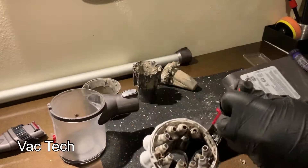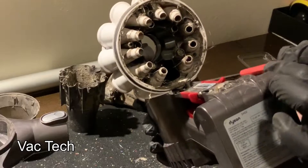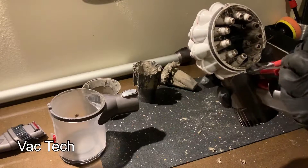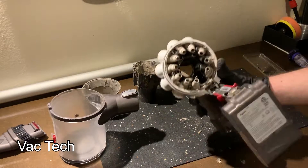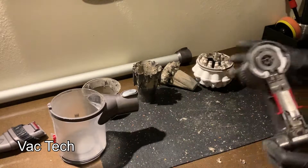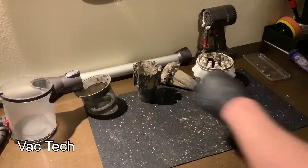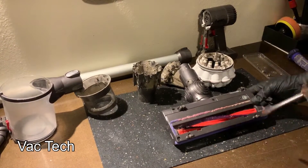To remove the cyclone itself, there are two small clips right by the motor — just push in on those. You can see they're little white clips. I had to work them evenly back and forth and the whole cyclone assembly top lifted off. This can actually be disassembled one further step, but unfortunately the screws to do so were stripped. So that was as far as I could take it apart before washing it, but it can at least dry completely before I put it back together.